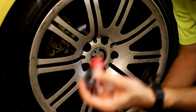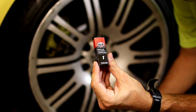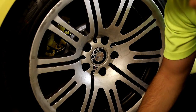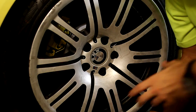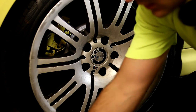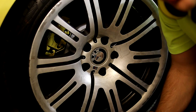I'm going to put a little bit of the first compound — the regular cleaning compound — and buff a little bit of that onto the disc. Now we're going to get started. I'm going to work the whole wheel, starting in the middle section, then going out on each of the spokes, and then doing the outside rim. You'll get an idea of what this cleaning compound does for the wheel, and then we'll move on to the polishing discs.